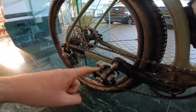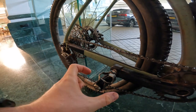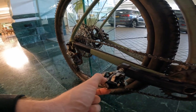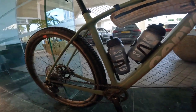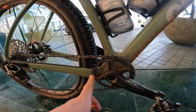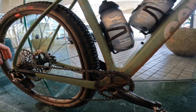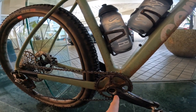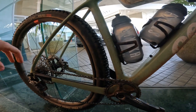The crank is XTR, and I'm using Garmin Rally mountain bike pedals — these are fantastic, I've been so impressed with them. One thing to note if you're considering these pedals is that the stack height is very high, so you need to accommodate that into your fit — your saddle height may need to be slightly higher. Currently it has a 32 tooth chainring on the front, which is fine for mountain biking but I'd say it's a bit too spinny for this. I was finding I was basically riding in the bottom of the cassette for most of the ride, so I'm thinking of changing to a 34 tooth and then changing the cassette to a 46, hopefully putting me more in the middle of the block.